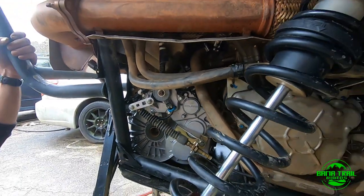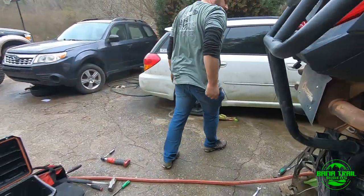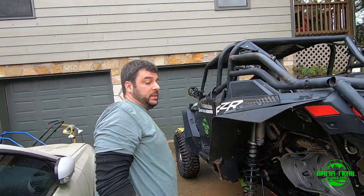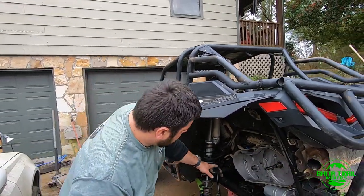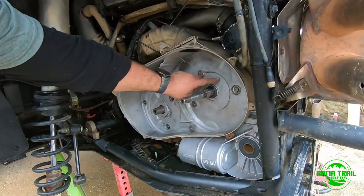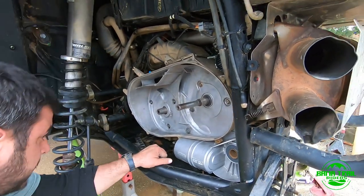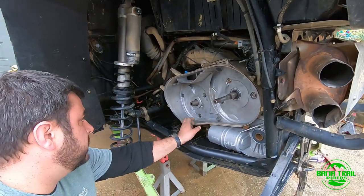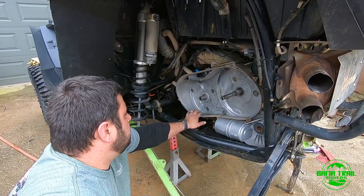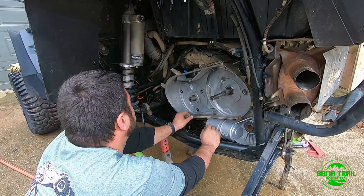And so go to the other side. Like we're done on this side, tightening those bolts and everything. So now, basic, you'll have to remember this big time. You got an O-ring in here. You have an O-ring in there. Make sure, and this is behind the case. I wish I could show you this before, but you need to make sure you put the seals in. If not, you're gonna get dirt and stuff in your bell case, but we don't want that. That's a no-no.